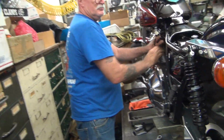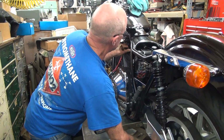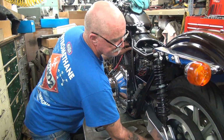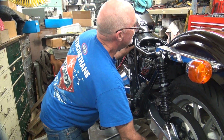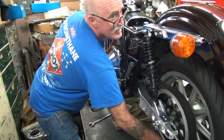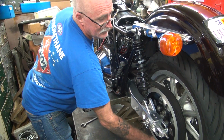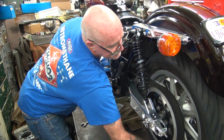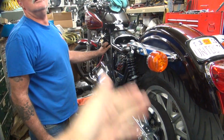This one needs to come up a little bit more. I think it's pretty high in the air to me. It's going down. I know, that's because you went down. Do you notice how it stayed down the whole time you did that? The screwdriver? Did you notice how the more you turned that wheel the wrong direction, it kept going down further and further? Now it's coming back up and going back down again. That's because you went all the way through that whole stroke. The screwdriver was hitting the piston. Then it didn't hit for like half a turn.